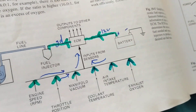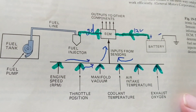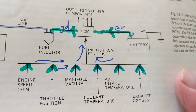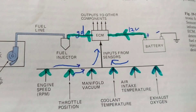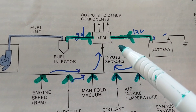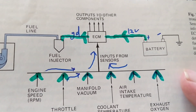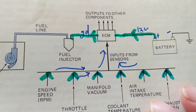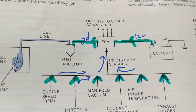Hello, welcome. Today this is a pictorial, not a schematic, so hopefully you'll get a better idea of what's going on upon starting your vehicle — any vehicle, domestic or otherwise. The ECM, obviously, is the computer — the Engine Control Module. It could also be called the PCM or ECU; same concept of a computer having control of the fuel line, the spark, the starter motor, and everything.